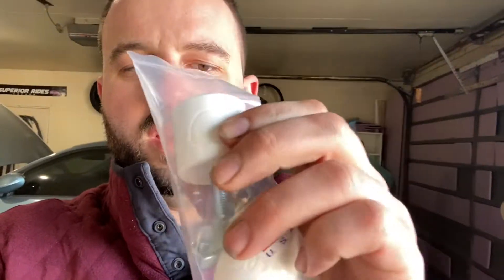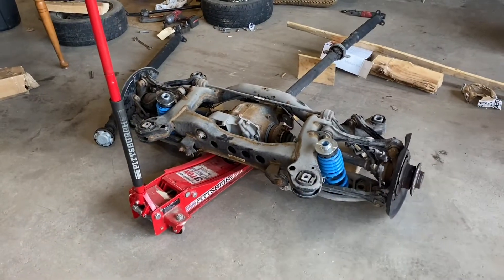Thank you to Condor Speed Shop — we already have a sticker under the hood for these guys, but there was no sponsorship here. I simply found them through the forums, thought it was a product I wanted, ordered them, and they shipped within two or three days. While I was on their site I also ordered their upgraded poly transmission mounts. They do make plastic poly mounts to match the subframe bushings, but I didn't want those for the drivetrain because that's more likely to introduce NVH — this is more of a cruising summer enjoyment car than a track build.